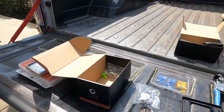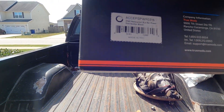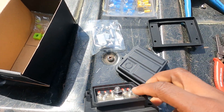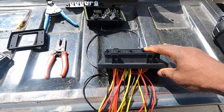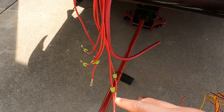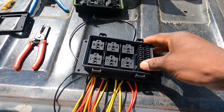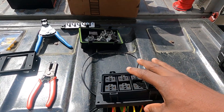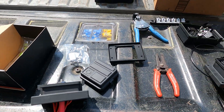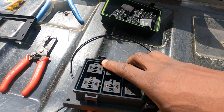All right guys, I'm back — a whole other day, a little bit more progress. We got the True Mods distribution bus bar distribution block right here. 12-volt power is going in and we can distribute that out to this relay box. All of these terminals are going to be coming into this relay box right over here. I'm figuring out where I want it situated in the vehicle, into my fuses, and then from my fuses back into the relays, and from the relays we're going out to the source that needs the power. That's our relays there — all of this stuff is weatherproof.